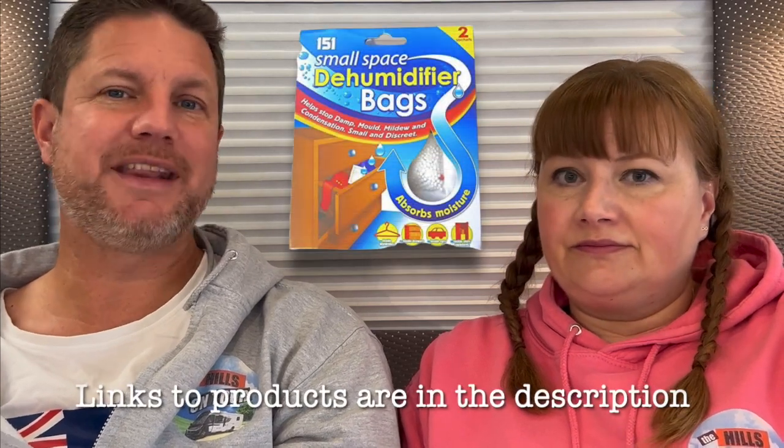Yeah, and if you are leaving your van unattended, if you're not using your van for any period of time in winter, the key is ventilation. People sometimes heat their van, which is a bit of a waste of money, but the main thing is ventilation. If you keep the air circulating, you won't get any damp. And if it's going to be left for more than a few weeks or so, get the cupboards open. It's all about getting the air circulating.